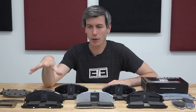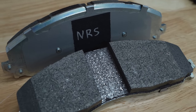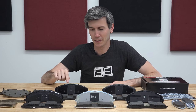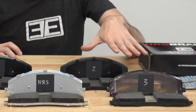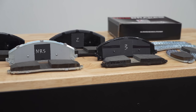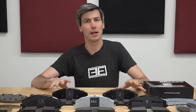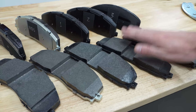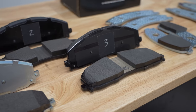The OE pads, as already mentioned, very clearly use a mechanical attachment. The NRS pads obviously believe mechanical attachment is the superior technology — hence they use it on all of their pads regardless of what the OE specifies. One aftermarket brand, owned by a major car manufacturer, also used a mechanical attachment. But two others surprised me. These are major players — tier one suppliers — not random small-scale brake pads. I'm intentionally not calling them out by name since this video is sponsored; the point is not everyone is playing by the same rules, and as a consumer it's nearly impossible to know what you're getting.